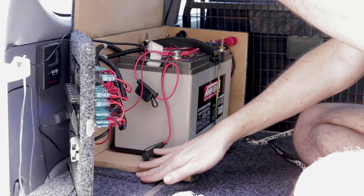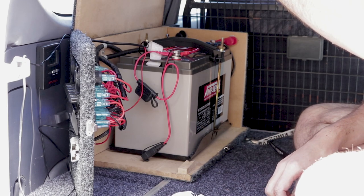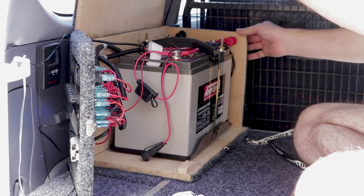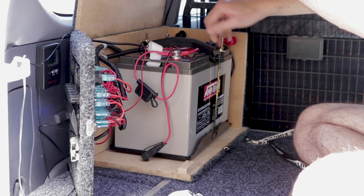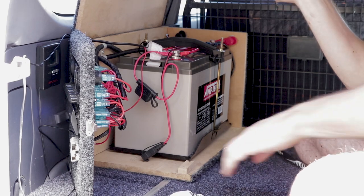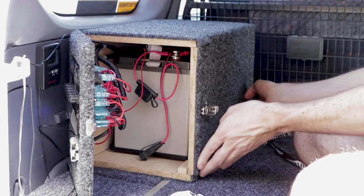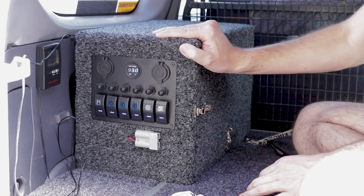I've just got a battery tray that's bolted through onto the wing of the Titan drawers here. I've also got to step that up so the fridge slide doesn't drag on the box — makes it move a little bit better. I've put some pass-through posts on the back of the box, with some rubber caps on there so nothing shorts out. The battery tray has a battery hold-down clamp here too so that doesn't go anywhere. This battery box is held down by three bolts through the battery tray through the wing. I just carpeted the thing and stapled it as well — lock that up, and that keeps it all secure.